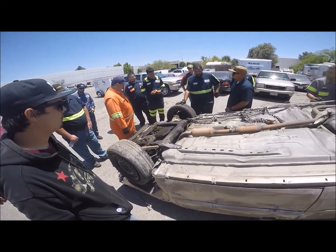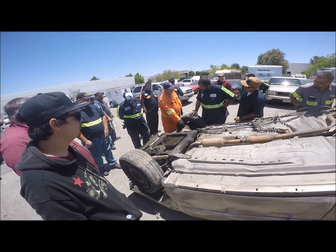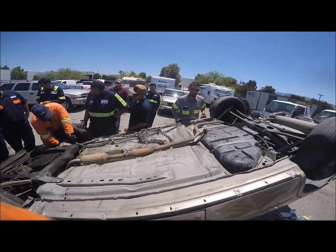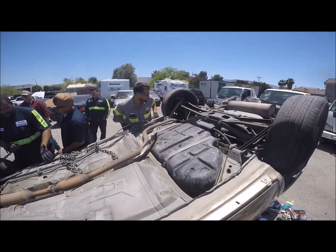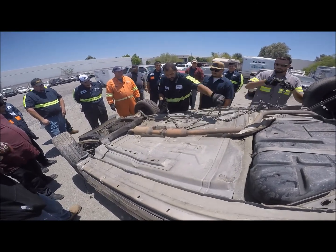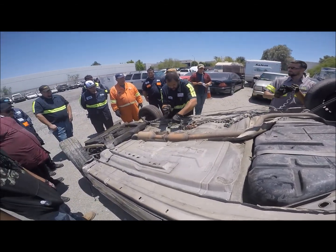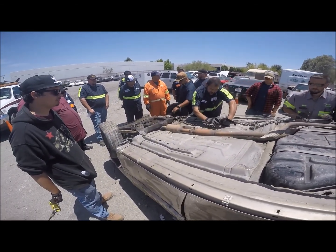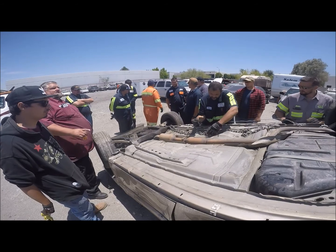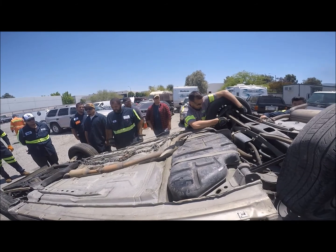They're designed for towing. Now, if you do it like this, when you go to unhook your chain, you've got to reach up under here to get to it. Instead of doing that, just make the loop bigger. Yeah, you can go bigger with those. Go right all the way back over to the center. You can go all the way to the hook if you want. And then on the back, go around both of them. Both the control arms? Yeah.